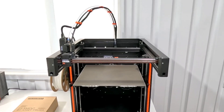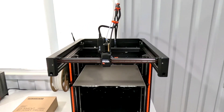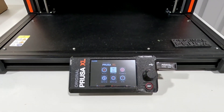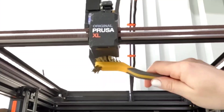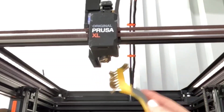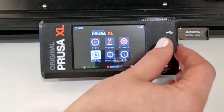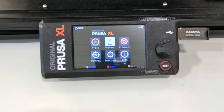After removing the filament out of the hotend, you manually adjust the tool head to be on the front and the center. Next is cleaning the current nozzle — it suggests to preheat and then wait five minutes. I did have a little bit that purged as it was preheating, and I go ahead and brush it. I don't really notice a huge difference. In the future, if it does not look like it needs to be cleaned, I'm not going to take the time for this, because then you have to wait for it to cool down.